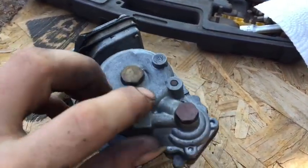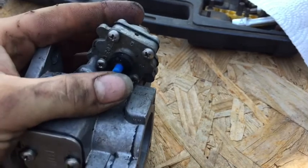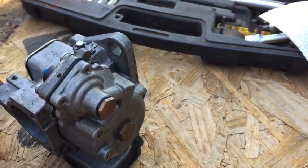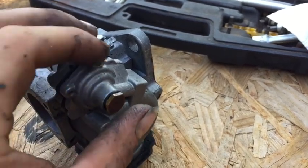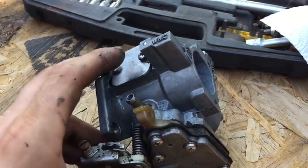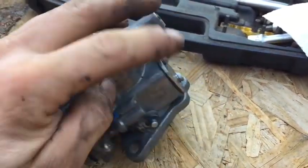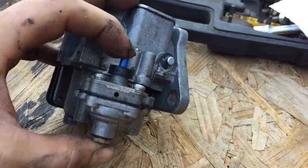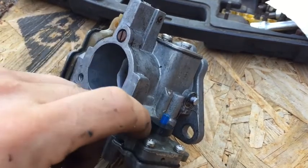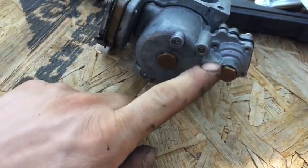I'm gonna flip it upside down. You can actually take the pump off with these four bolts or screws. If you buy a carb kit, they have all the pump parts in it. I did not buy a carb kit — I'm just gonna see if I can get it clean without doing the full kit. I don't know the history on this engine, so I'm gonna pull the bowl off and see how it is. The accelerator pump feels good when I squeeze it and I can hear it pumping, so I think the diaphragm is still good.